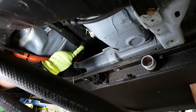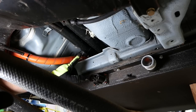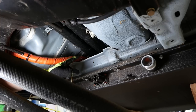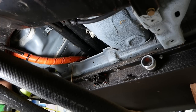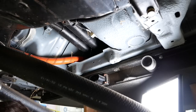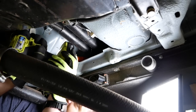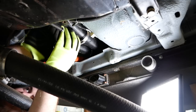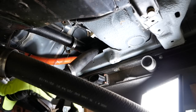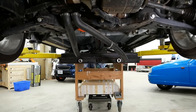There are more hoses I missed. Turns out these are both the inlet duct, and the two other hoses were both the return duct. But the hose clamps are way down in there — no way I have access to them. It looks like the hoses clip onto a manifold held on by six screws, so I tried a long bit screwdriver — but it's stripped. Another plan is to disconnect the hoses from the other side and pull them through. It didn't come out particularly easy, but it did come out.